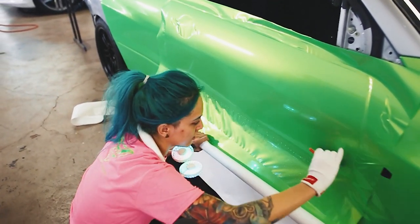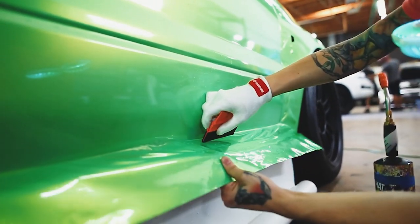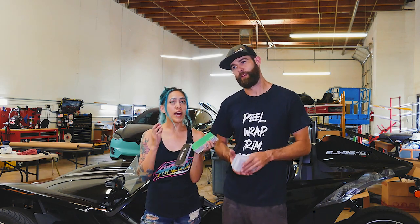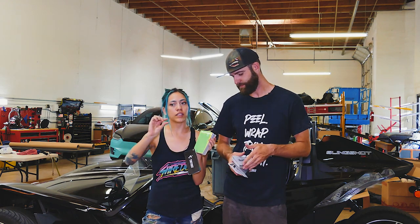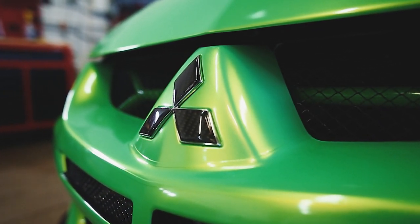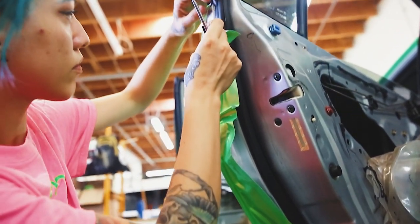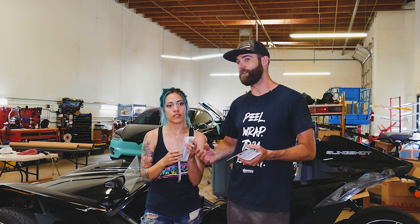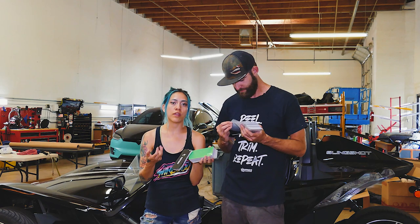The next thing you need to know is this film doesn't do deep stretches or conformable recesses. With the bumper, for example — we may have been able to do it in two pieces in cast film, but I did it in eight pieces in calendared film. You have to break it down into a lot more pieces. However, the seams hide very nicely — if you make a clean, consistent overlapping seam, it disappears. The reason is that the adhesive is the same color as the film itself, so you don't get a little white lip wherever you have a seam. This film hides seams very well, but you need to incorporate more seams than you would with a cast film.